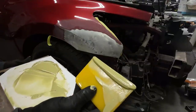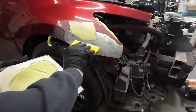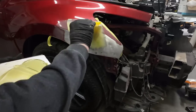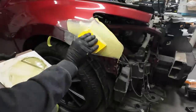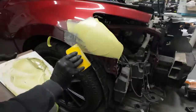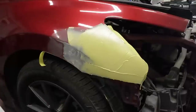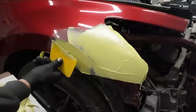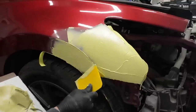I want a controlled amount of filler. The first coat we're going to press it into the panel, going with the contours of the body. We want to press it in so we get good adhesion and also press out any air that's in the filler. As I continually go over this and coat it, I'll ease up on the pressure to allow that filler to sit in those low spots. I'm laying some filler on it and then spreading it along the body contour so we have that nice body line forming.